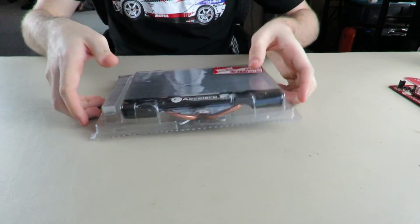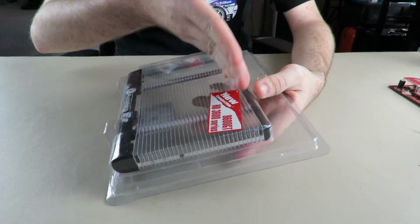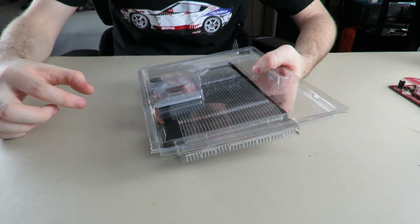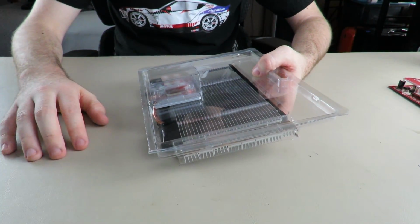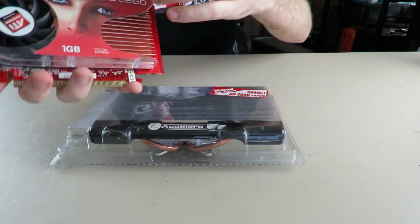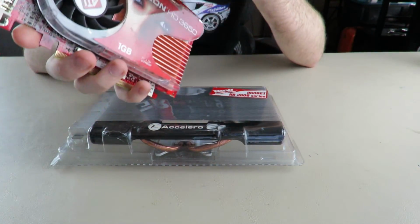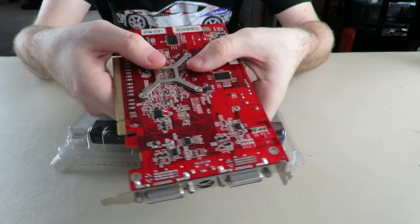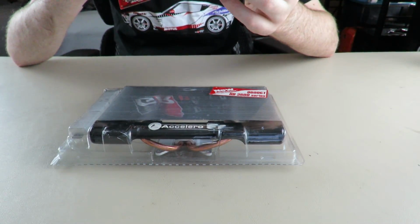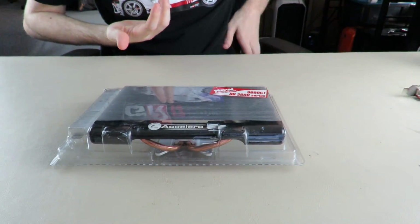Because yeah, it's got heat pipes and everything, but that fin density is so low, and it's only 2 heat pipes, and it's just a little piece of copper. I was astonished. This is a full copper block with a fan. And it's not like it had bad mounting pressure. This thing is really squished on, and it's not angled or anything. I made sure of that.